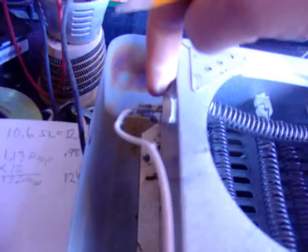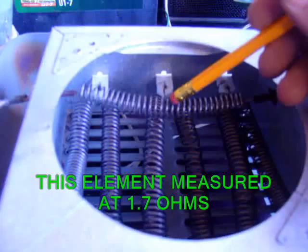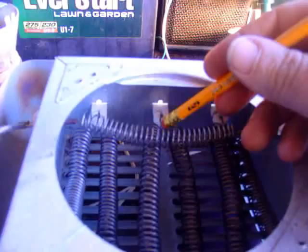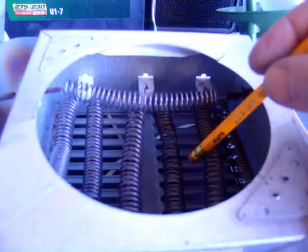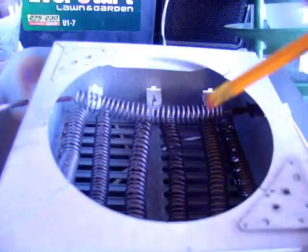As you see this right here, looks how it slides in and out. I'm going to have to put a pin in there, just like they've got right here. This element right here — nichrome resistance wire, I believe, or tungsten — when I put the ohmmeter across there and really mash hard to make sure it gets a good reading, I've got 1.7 ohms. This is 1,300 watts or 1,500 watts. It usually runs this one and this one in series for 1,500 watts, and then just these for the lower wattage. 1.7 ohms divided into 12 volts: 12 volts divided by 1.7 gives me 7 amps. 7 amps times 12 volts gives me 84 watts just for this alone, because the resistance is so low. But this longer resistance isn't going to do me as much good for 12 volts. This measured out to be 10.6 ohms — that's 1.13 amps. 1.13 amps times 12 is 13.56 watts.